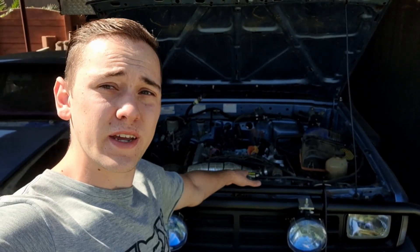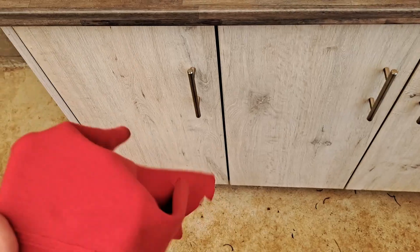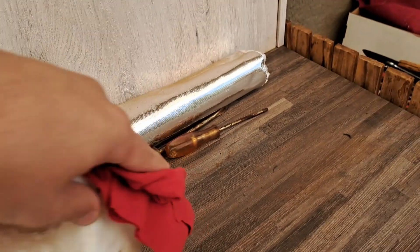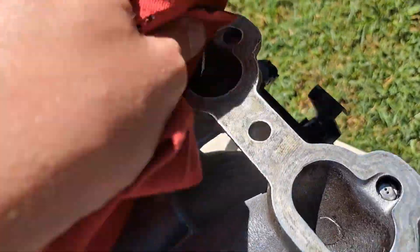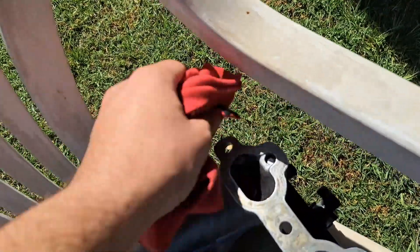It is the next day. First order of business is cleaning up all the surfaces so that they are ready to get the gaskets on — or gasket and RTV, because we couldn't find all of the gaskets. To do that, you'll just need a shop rag and some acetone. You just apply the acetone to the rag and wipe down the surfaces. The acetone helps dissolve and clean up anything left over that you couldn't scratch off with the Minora blade earlier.